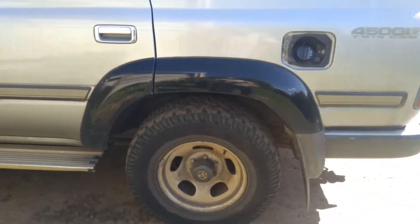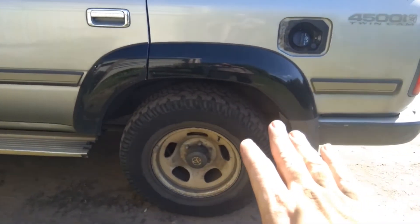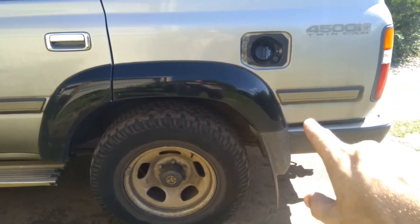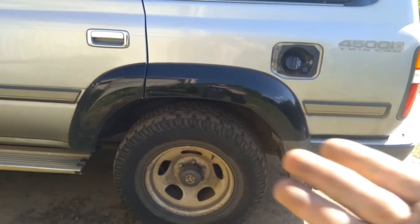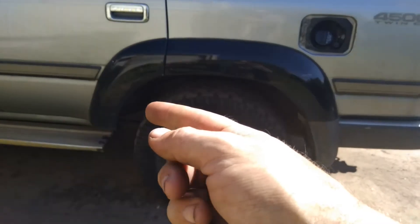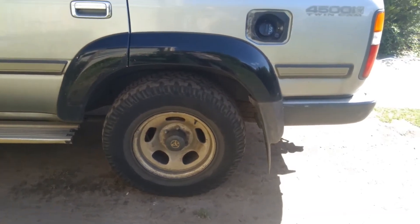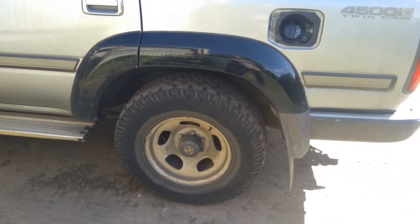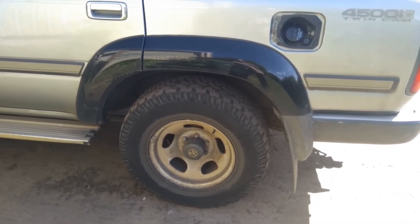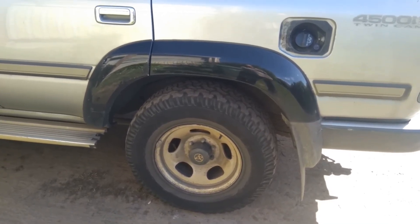Remembering I've got the GXL update model — I can have 90 litres in the main, 50 litres in the back, but if I'm at half a tank on the main, it's not going to pump 40 litres back in. It'll only pump it to around two thirds to three quarters of that 90 litre fuel tank. Hopefully that helps you out and helps anyone else that's interested. Don't forget to stay tuned tonight for 7pm Australian Eastern Daylight Time — the Backyard IT Lifestream Conversations. We'll catch you in the next video, thank you very much for watching, please like, comment and subscribe. Cheers.